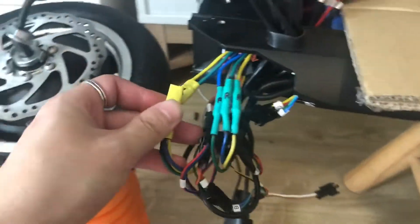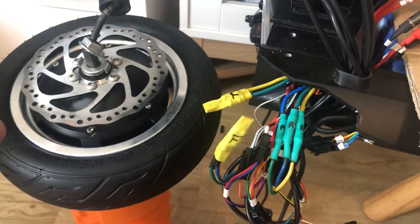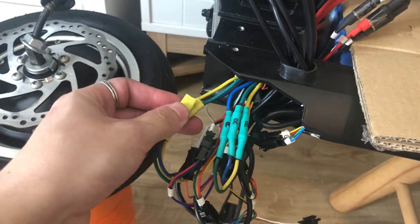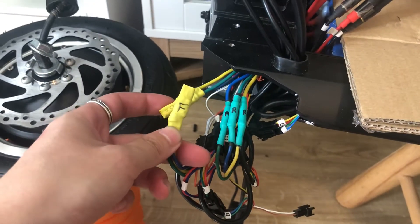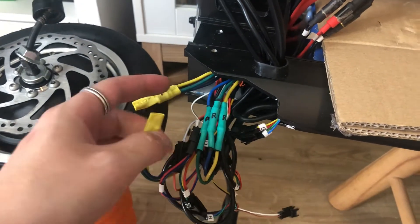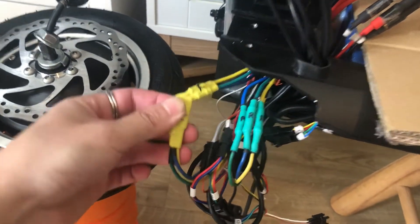That's the diagnosis — by swapping the cables you can get the other wheel to spin. If you have dual wheel drive and you need to use your scooter while waiting for a new controller, you can disengage the front motor controller cables as I've done here.